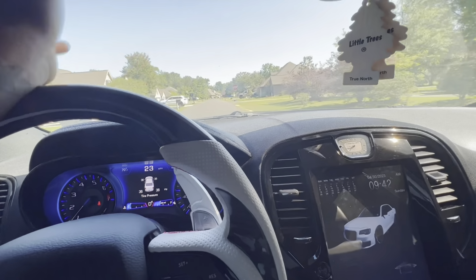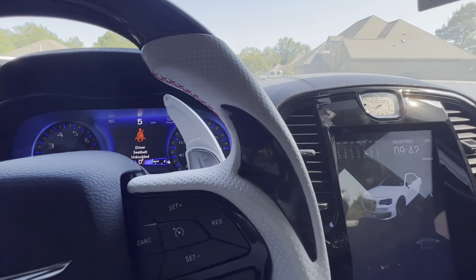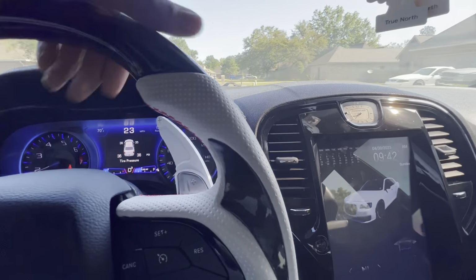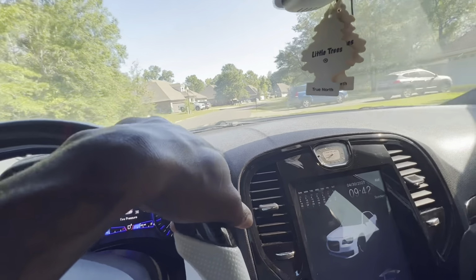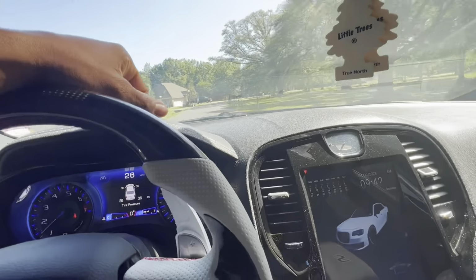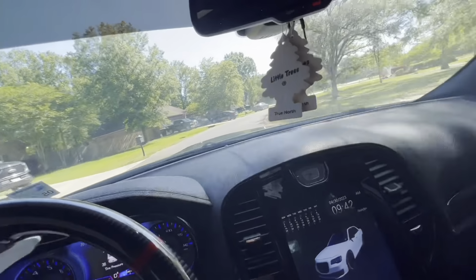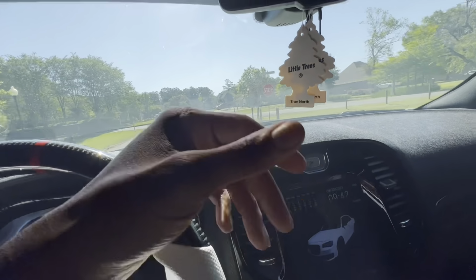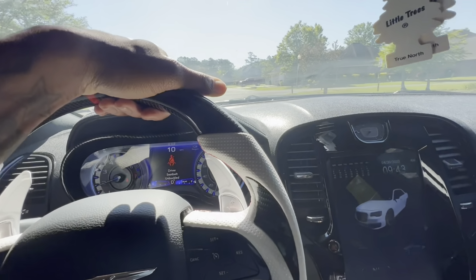And the tuner gave me a whole explanation on why he tuned it like that. Because, again, the plan is to turn the boost up. And that was always the plan. I just never had a set date that I was going to turn it up. But we had it running a little more fuel for when we were ready to do that. Not to mention that pulley to get it in boost faster, all that stuff, it's gonna need more fuel. So that was, in a nutshell, the reason we had it pushing a little more fuel than what it needs.